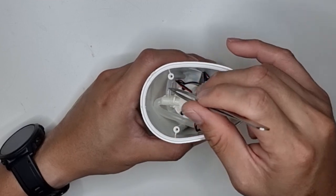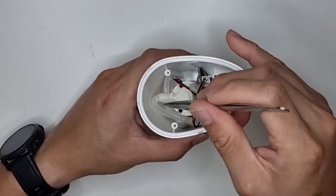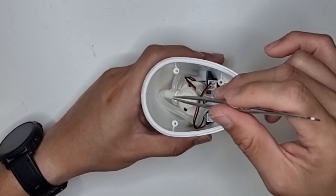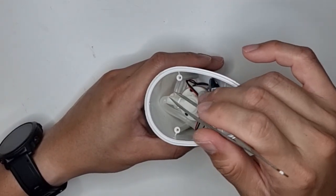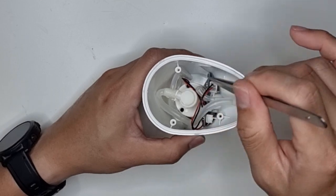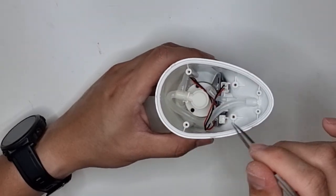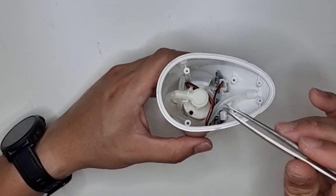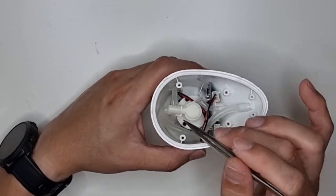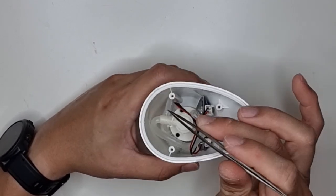The original tube was actually long enough for me to cut out this short segment, and then I found a way to reroute the shortened soap intake tubing. But I have to be careful because the original one was long for a reason. It was long so that it could go one loop around with a large bend radius around the pump unit. And this was intended by the designer so that no kinks are created in that soap tubing, and the soap could flow freely.